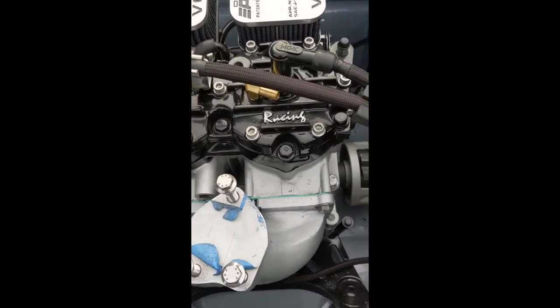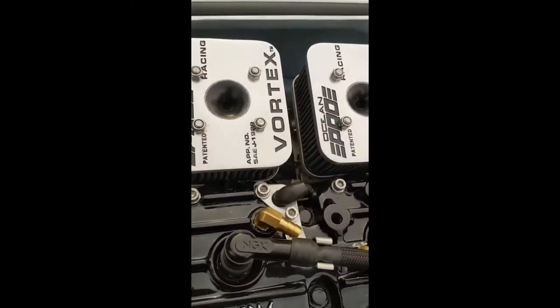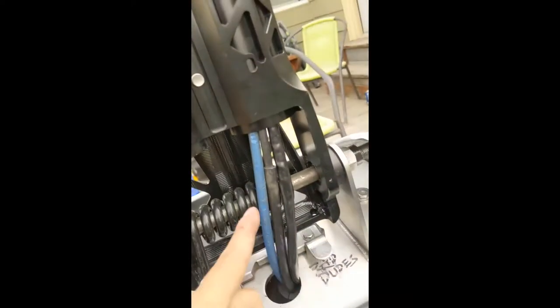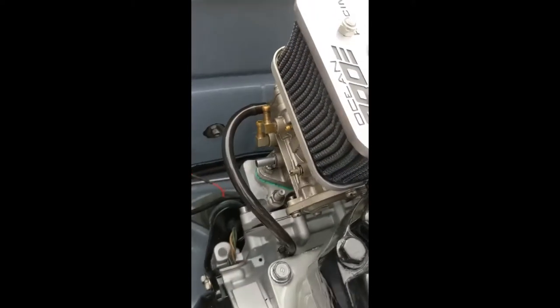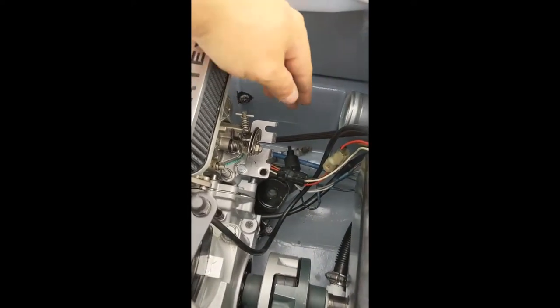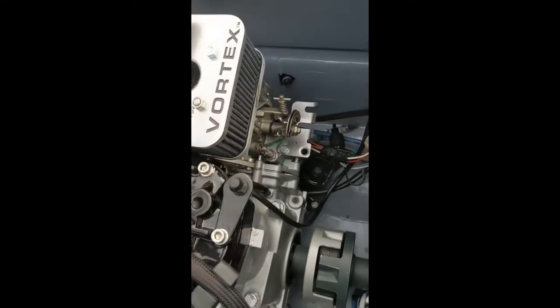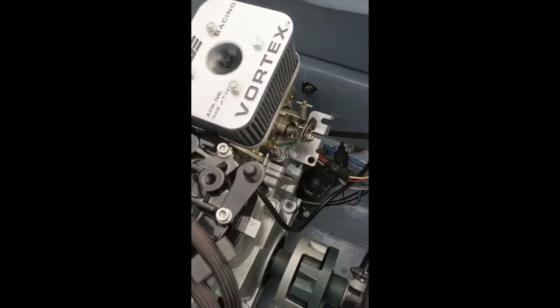The next two things you're going to be doing, well, several things. I've got hooked in the fuel lines, so I'll go over that next. You're going to do the throttle cable system here. So you got to hook that up to your handle pull, which is this blue cable here. This goes up your handle pull, and it goes over to here. This is a kind of a different setup, so normally your throttle cable will go right here. So this is a 760 bracket, because I'm running dual carbs, dual 44 carbs with a 760 manifold and so forth.